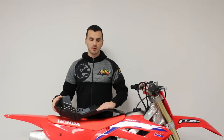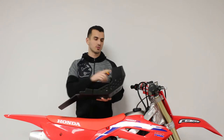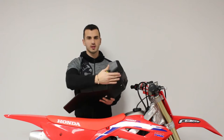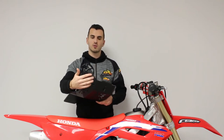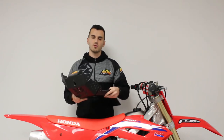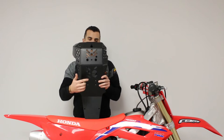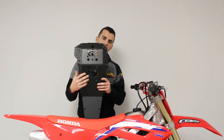In this video I will talk about the extreme skid plates which has a very good protection from the linkage to the front. So you have the linkage protection, you have a full frame protection on the side from the water pump to the foot peg. You have also the water pump coverage which is on the side and also on the front with this part. So you have the exhaust coming just here. You have this part in the front to avoid the mud to come inside. And you have also a good coverage on the left side with a small window which allows to change the oil filter without removing the skid plates. And finally you have this hole in the bottom of the skid plates to drain oil without removing the plates.